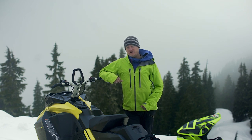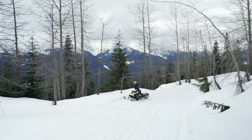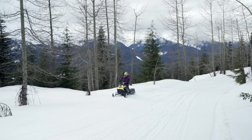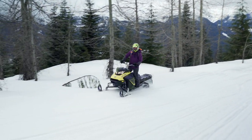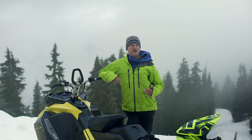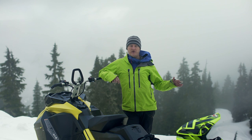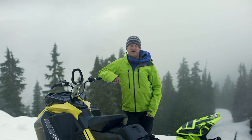The first thing that you're going to see is a red warning light come on the display and you'll also hear some beeping. When that happens you need to take action straight away. The first thing you can do is ride your snowmobile straight into some soft snow, and that will immediately throw a lot of snow under the tunnel and it will cool down almost straight away. Sometimes you don't get that opportunity because the snow banks are also frozen on the side of the trail.